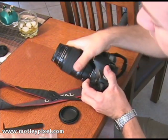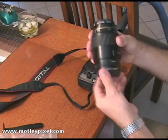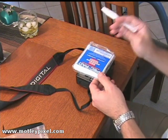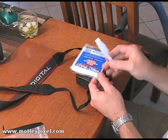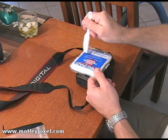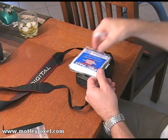The first thing I'm going to do is remove the lens, place the camera cap on, and get it ready for cleaning. I'll put the lens cap on the back of the lens — this is the 100mm macro from Canon — and I'm ready. Now essentially what we're going to do — I'll simulate here so it's easy to see. Let's say this is the sensor filter. The sensor swipe is wedged like this. You insert it all the way to the upper left corner, press down, swipe across, then lift and go to the other corner and swipe back. There's about a 2 to 3mm overlap in the center.